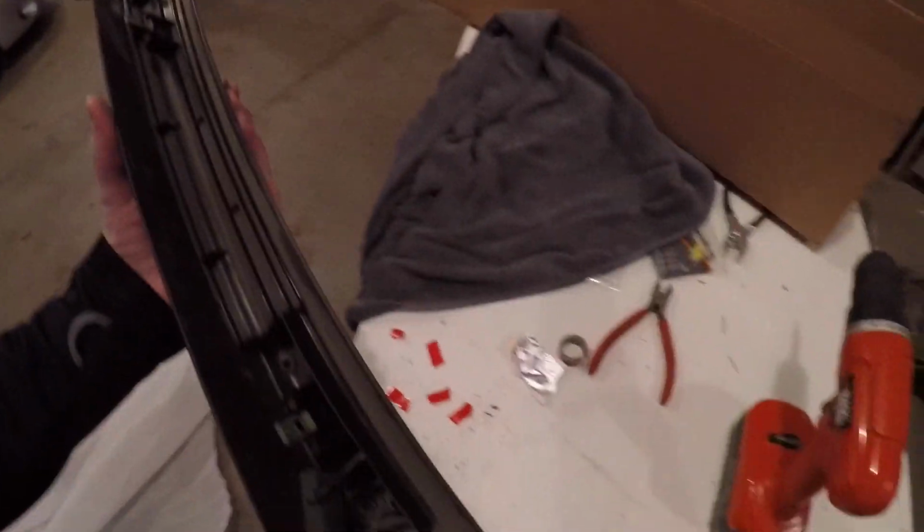So I'm gonna go ahead and take that off. I'll show you the steps along the way, so give me 1 second. Let's get that first one removed. Okay, got the first one removed. There you go. It's hecka scary, because there's one Christmas tree pin that goes in that hole there, and on the back there's 1, 2, and 3 clips, and those are terrifying to remove. You're also going to want to pull your trim aside.